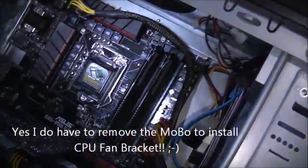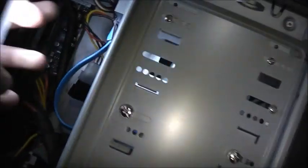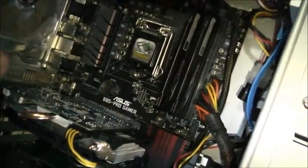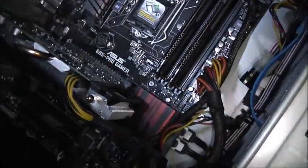Just waiting for the CPU and the other 8GB RAM sticks to arrive and she's done — should be here by Wednesday. I've got this good 45-degree angle SATA cable out of an old trash-picked Dell from the side of the road. The angled ones are better, manage the cable a lot easier. I've only got two 6 gigabyte-per-second cables from the motherboard — one's 45-degree and one's straight. SSD is down there — beautiful. I've got room for more hard drives and I'm probably going to get a 3TB drive at some point to store all the videos and music on.